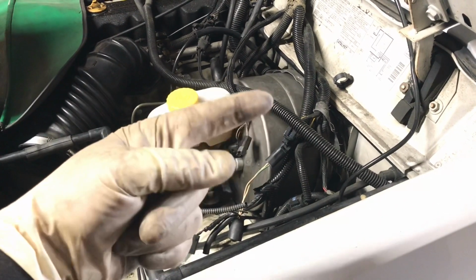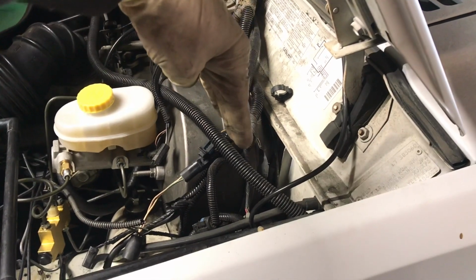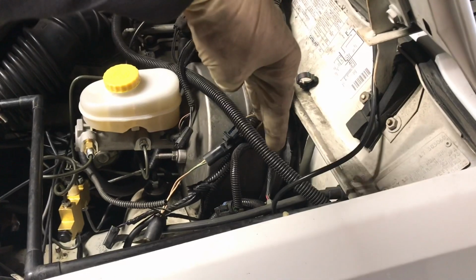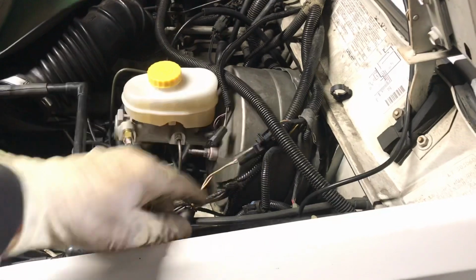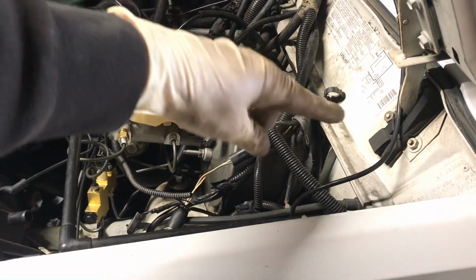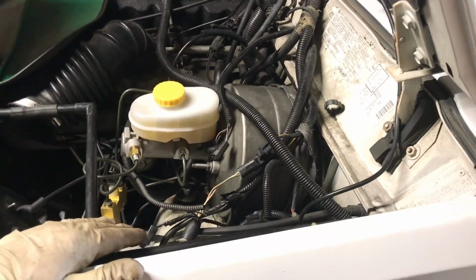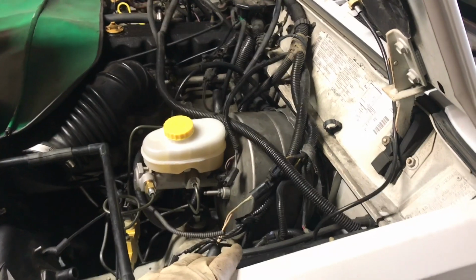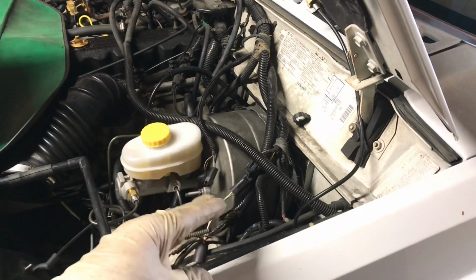It's not that much, so I added a washer on the upper 2 bolts, so it propped it, gave it just a little bit of an angle, so that changed the push rod inside, so it lines up a little better. And I think just that extra width of the washer, I'm not getting it hanging up anymore. Still getting a lot of travel with the pedal, and I stumbled on another forum, somebody who'd done this, and